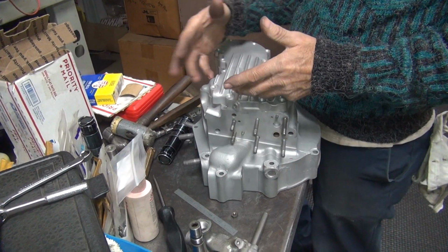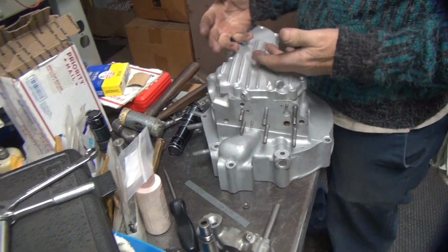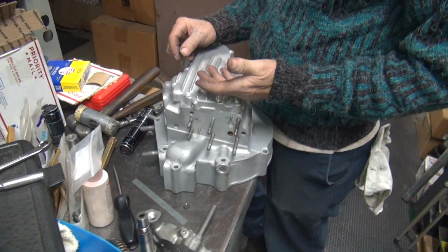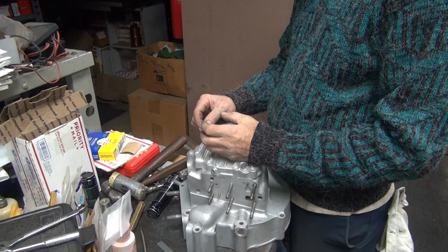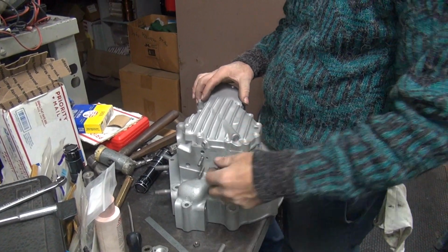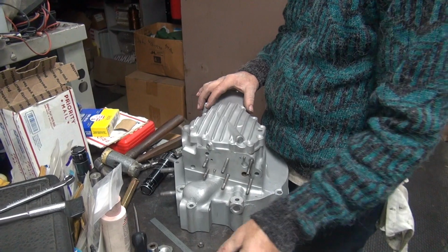That's why everything has to be semi-loose so it will work. If you get it too tight, the alignment has to be perfect, which you won't get with this fit. That's the problem I have with my stuff. I try to make the holes too precise, too tight, and then it causes problems because there's no built-in misalignment. A little bit of misalignment, like the studs binding up on this, makes the pumper not go on. It made the shaft bind up until we got it squared away.